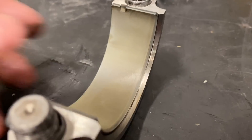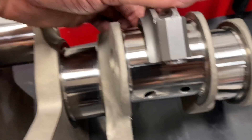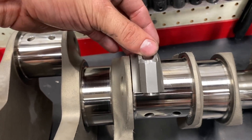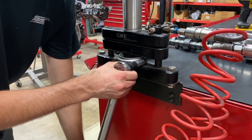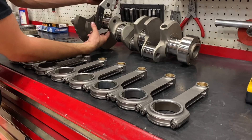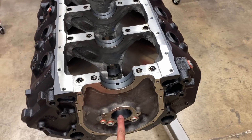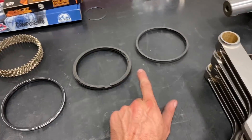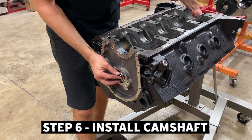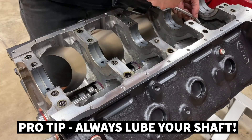The rod bearings I use in these engines have a chamfer on the side that goes up against the fillet of the crankshaft. That gives the rod extra clearance so the rod and beam can freely move up against the crankshaft while the engine is running. Cam bearings are in, main bearing clearance is set, rod bearing clearance is set, piston rings are gapped. Starting with the camshaft — I put the cam in dry first so I can freely check that the cam bearings are totally straight and in line with each other, then I'll push the cam out just a little bit and lube all the lobes and the five journals.